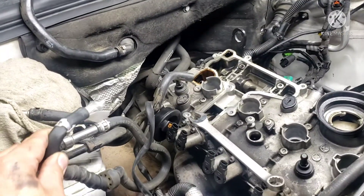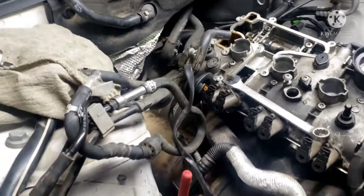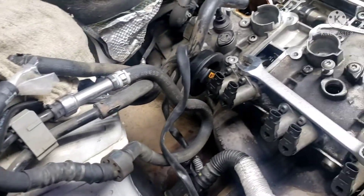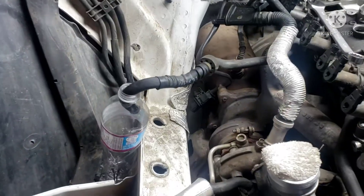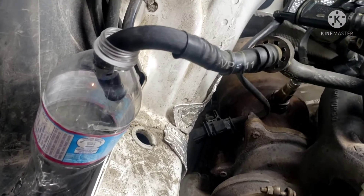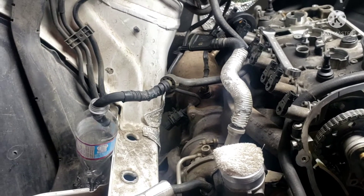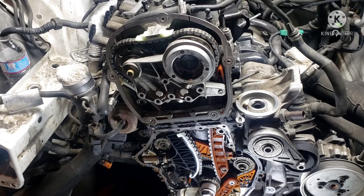So I think this is ready. This is the fuel line right here - I put a plastic on that so I won't smell the fuel fumes all day. I'm a little worried so it's better to put a container here just in case the fuel pump did turn on, you don't want fuel spraying all over the place. Just for safety I'm going to put a container and put the high pressure line on the bottle. I believe we can crank the engine - no start, just turn the engine - and put a gauge to see what kind of pressure we have on each cylinder.